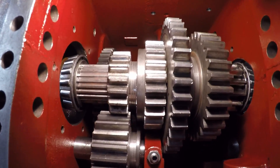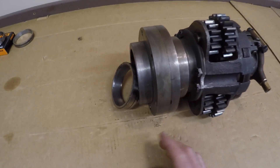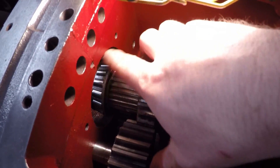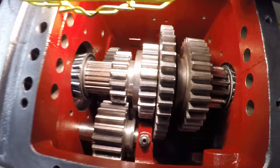This is about as far as I'm going to go with this video. We got the top shaft in; it's filling up in there and starting to look like a real transmission. But I have not put the rear bearing race in yet and I don't have anything to support the front bearing race — because this bearing support housing slash one-way clutch assembly is what holds that bearing race for the front bearing. Until I go through that piece it doesn't pay to do anything else here. I'll get that front support in with the bearing race, support it at the front, put the race in the back, tighten the nut down, set the end play, and check how everything goes. Thanks for watching — the plan is to keep throwing parts into that housing and I hope to see you guys back next time.